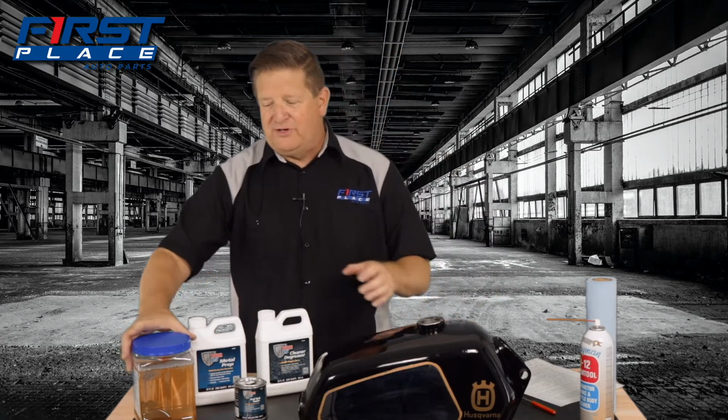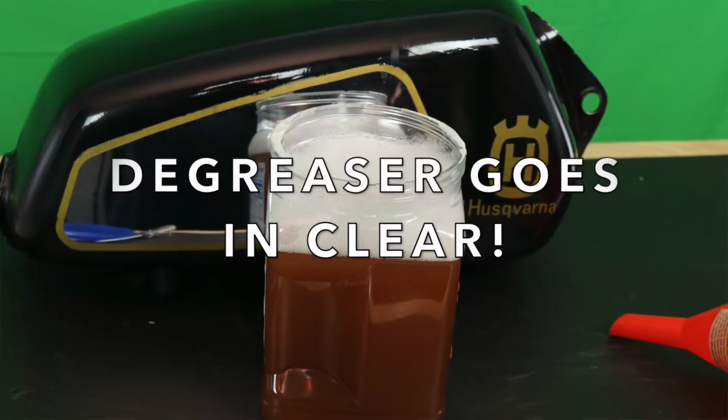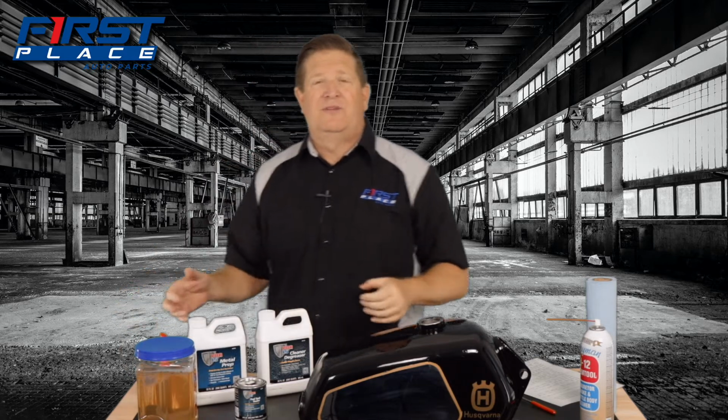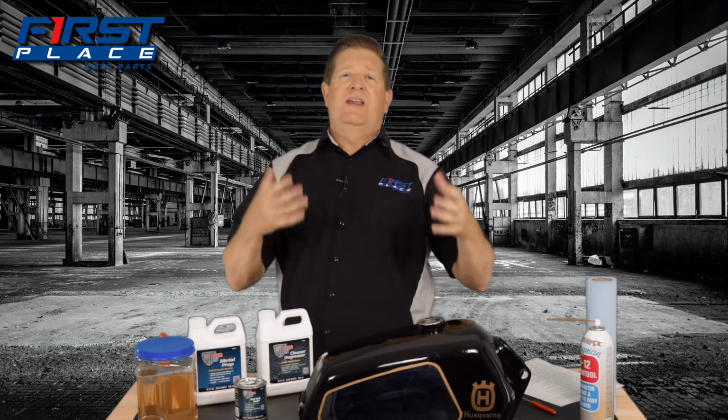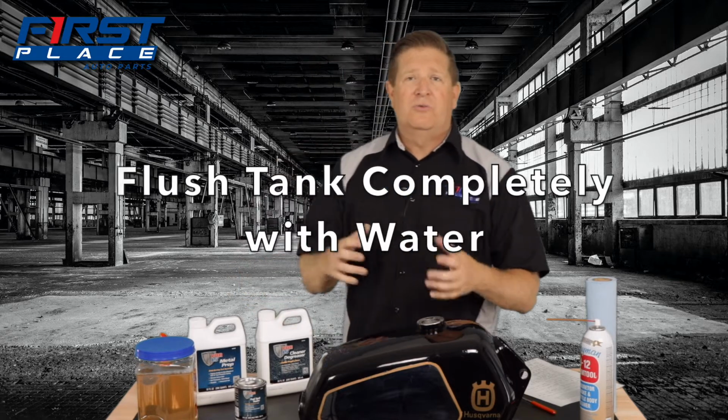Once you've done that, the material that you drain out is going to have a ton of rust, rusty debris in it, and whatever else is in there, any kind of oily substance. So this product works. Then after you've added the degreaser, you wash the tank out with water, take it out to your hose, wash it out. It doesn't have to be perfectly dry for the next step.